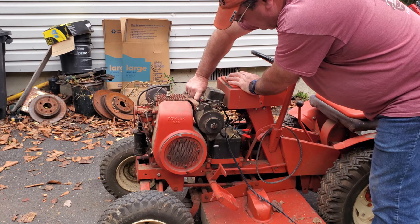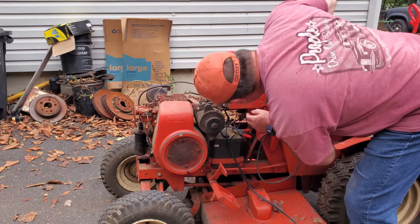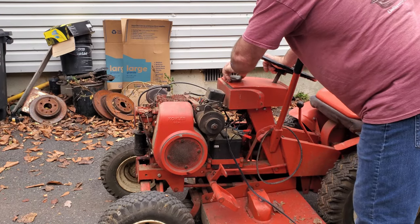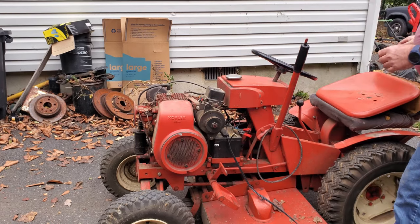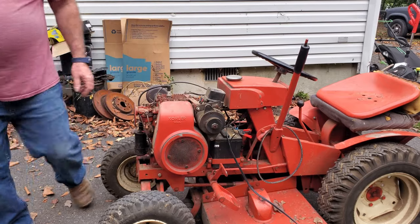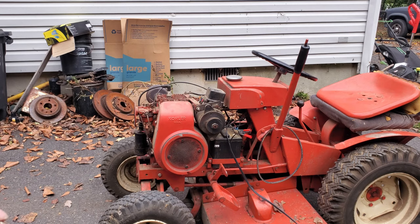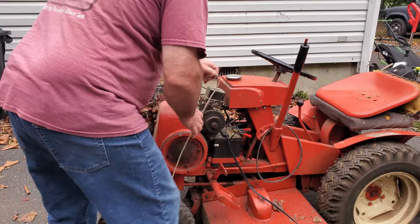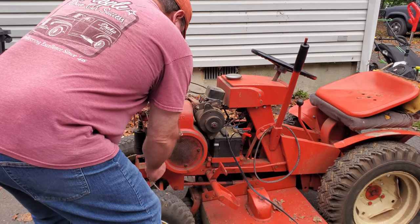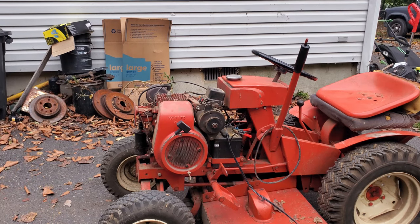This may be what was making the noise in there. The bowl is not filling up — it may just be that the fuel can't flow because the float is stuck shut and it's not letting any air go through there for the fuel to follow. We'll crank it over a little bit more once I find the rope, see if we can suck some of that fuel in here, and turn the key back on.